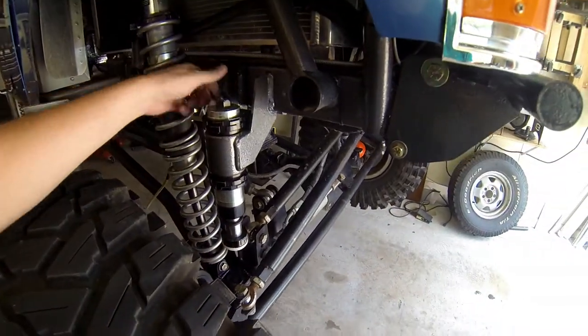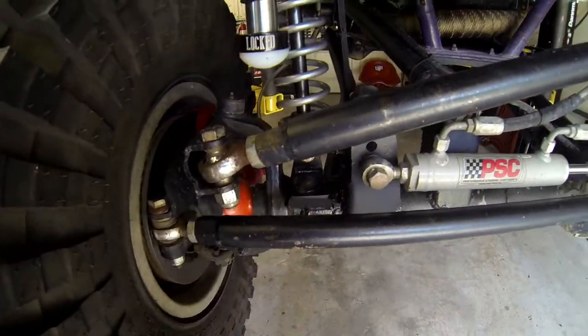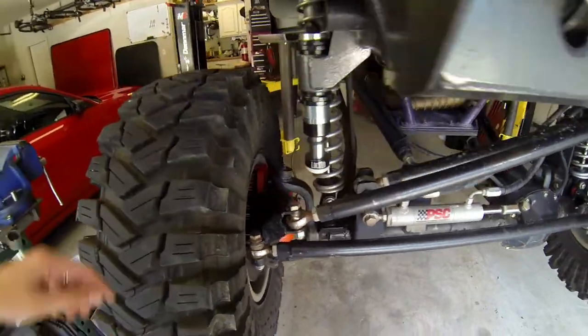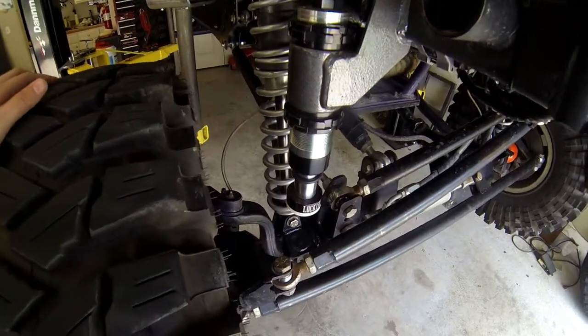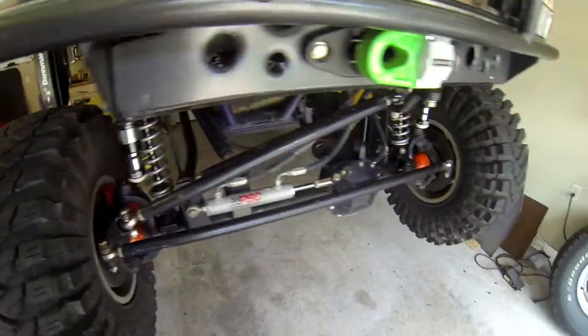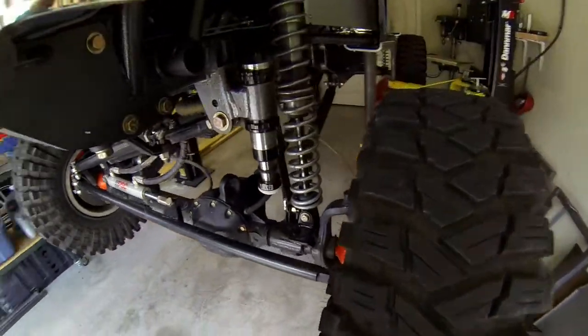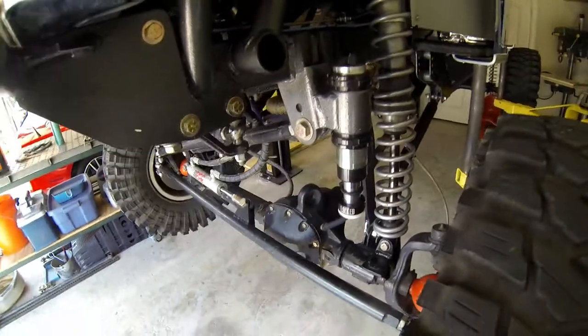You can see I've got them on the front, mounted up onto the frame rail here, and I've got the pads down there on the axle. I had to clearance this a little bit so it wouldn't hit the bump stop, and I just adjusted it so hopefully while I'm out there it doesn't hit anymore. I really don't feel like pulling these coil overs apart to cycle the suspension.